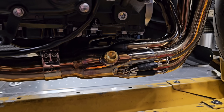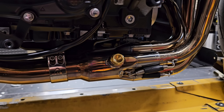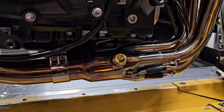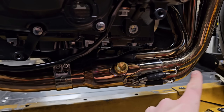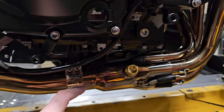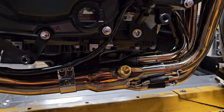You should know about these differences before you decide to purchase one exhaust system versus another. A lot of folks are probably wondering why any exhaust manufacturer would choose to make a four-into-one design knowing it doesn't flow as well, and my assumption has always been down to cost. You simply have two fewer pieces of pipe when all four head pipes go straight into the collector versus going into two first. It's just cheaper to manufacture, and this header design is commonly used by a lot of the knockoff or budget systems on the market.